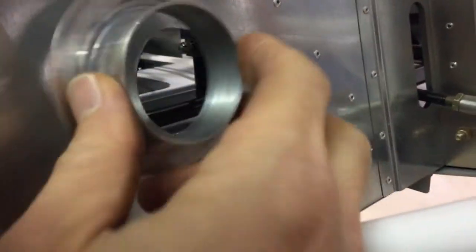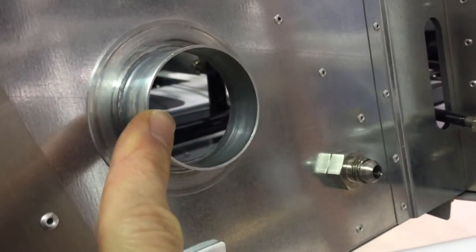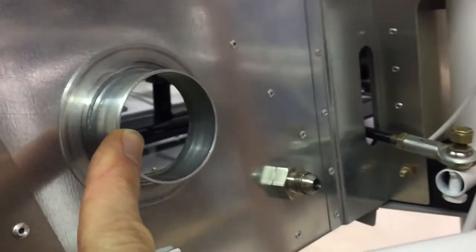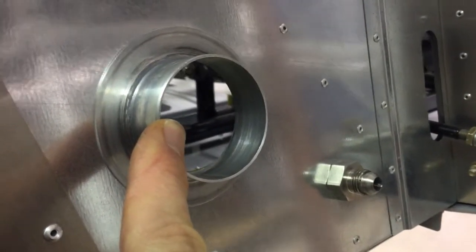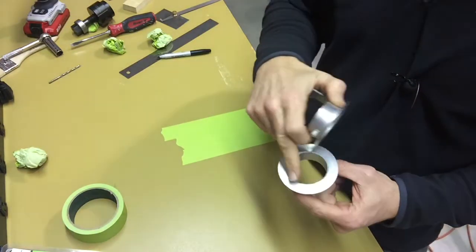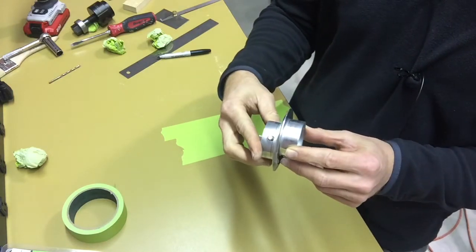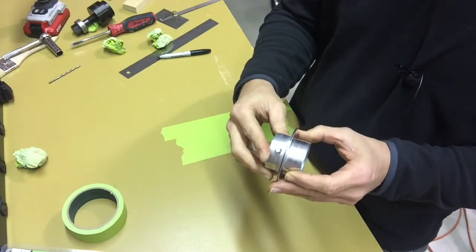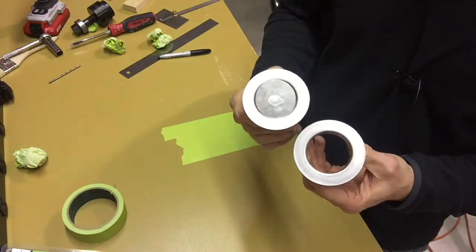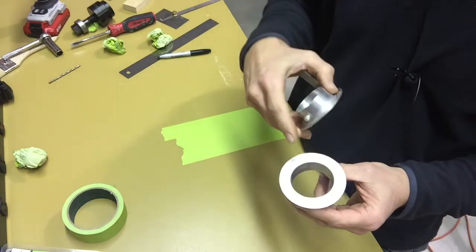There it is — here's how this fits on here just like that. Now just match up the inside piece, drill some holes, and rivet. The final step in mounting this is to drill holes around here, match drill it, put it on the firewall, match drill through the firewall, and rivet it together. The factory Cruiser, from what I've seen in photos, has four rivets going around here holding it. I personally think five would be a little better.